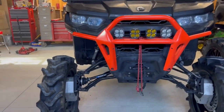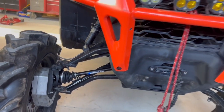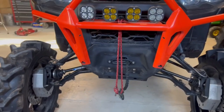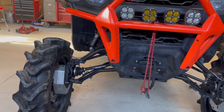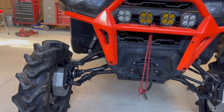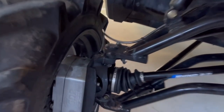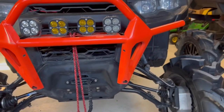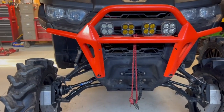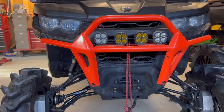You can see we've got a Rhino 2.0 axle in there — that's what we replaced yesterday, the front axle. We broke that axle three times now. I think the tire gets overextended and it pops that knuckle right there in the corner. It does have two-inch forward A-arms, high-clearance A-arms on it.